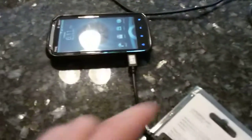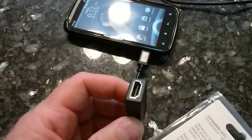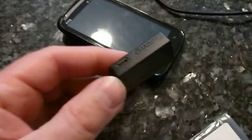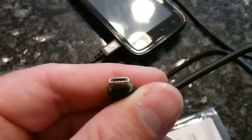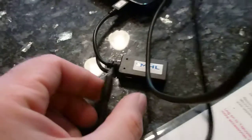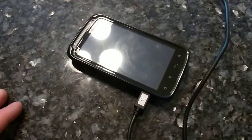The phone just came back on, but here's the deal. If you just connect an HDMI cable to this and connect it straight to a TV, you will notice that it will not play. This needs power. As you can see on the side of this, you have a micro USB port where you take your included charger and cable and plug it into the micro USB port right here. That's when you're going to get the power and your phone is actually going to send the HDMI signal out to the TV.